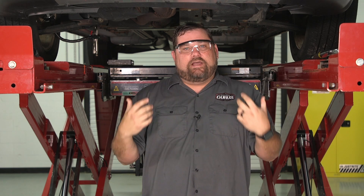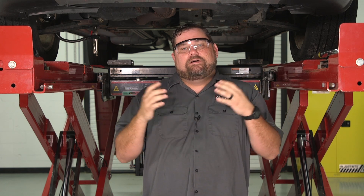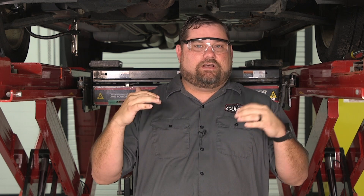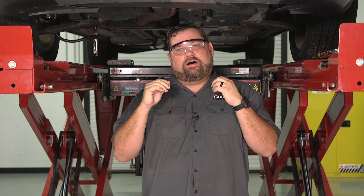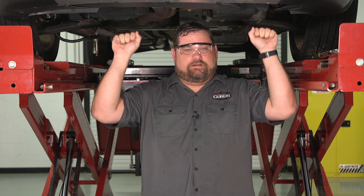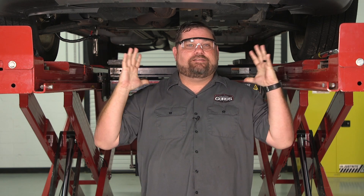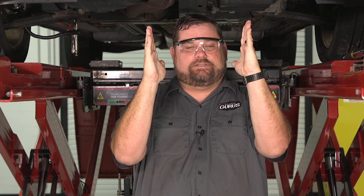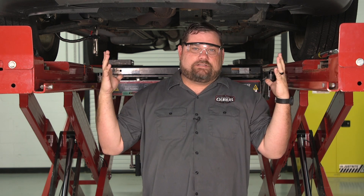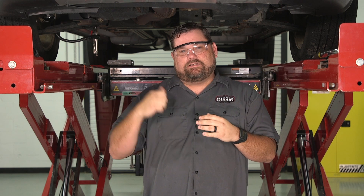I'm going to grab this air jack and bring it to a safe, correct lift point to raise it just high enough to get the tools underneath the tires — about two and a half to three inches. We want to focus on getting the tool right in the middle. The first inspection we'll do is in the in-and-out direction of the tires, so I'll work it up and down from the inside of the vehicle to put force in that direction. We can inspect ball joints and bushings as we do that. This car does have a complaint of a noise in the right front, so hopefully we'll be able to find it.